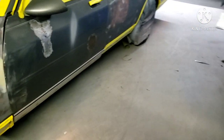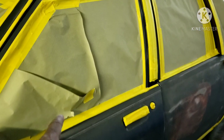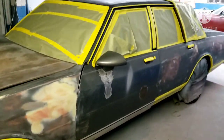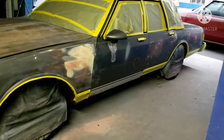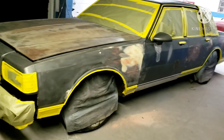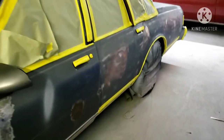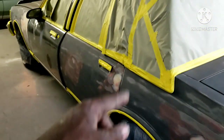Still gotta change this door — got the door, ain't nothing wrong with it, that's why I didn't change it yet. I'm gonna show y'all that in the next video. Finna throw two coats of primer on here, let this prime dry overnight — the primer I get needs at least three to four hours to dry. It's already late so I'm just finna throw these two coats on, come back in the morning, find all my imperfections, finish them up so I can get this car ready to paint. We gonna paint the door jams and everything too, so y'all stay tuned.